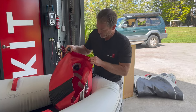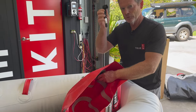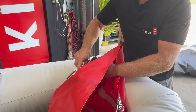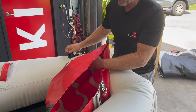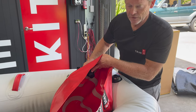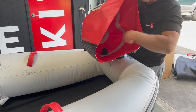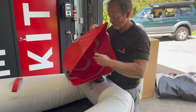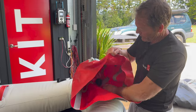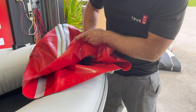Now I'm going to show you with our demonstration part tube how to replace an inflatable boat valve. Get your tool, insert it into the valve, anti-clockwise — it'll take about three turns to separate it from the basket. Here's a tip: if you don't have the basket sitting flat on the ground, the basket can end up floating around in the tube and then you're going to have to chase it around and try to relocate it. So the tip is when you're replacing the valve, do it flat down so the basket is sitting flat so it can't run away on you.